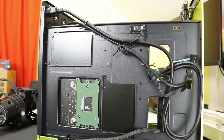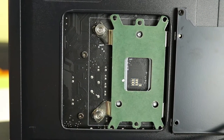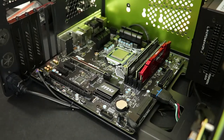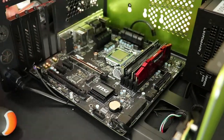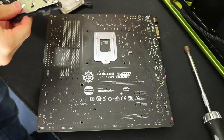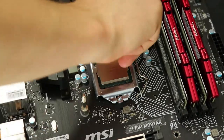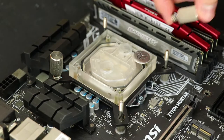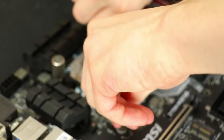As for installing the CPU block, the full area of the CPU socket is not accessible through the rear of the motherboard tray cutout, so the motherboard needs removing entirely from the case to install the CPU block. While this is a pain, it really doesn't take that long — get yourself a ratchet screwdriver with a long shank and you'll have the motherboard out in less than a minute. First off is the rubber gasket and steel backplate for the rear of the motherboard. The front then takes two-sided bolts which team up with the backplate to support the CPU block. After a touch of thermal paste, we lower the CPU block onto the CPU, then springs are lowered over the bolts to regulate pressure, and thumbscrews are placed over the top, tightened in a cross-like pattern.